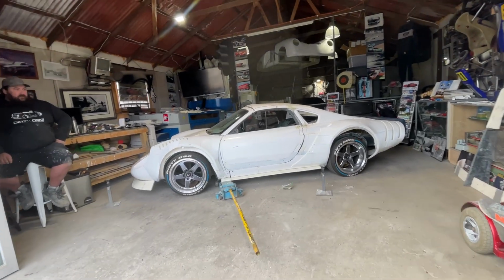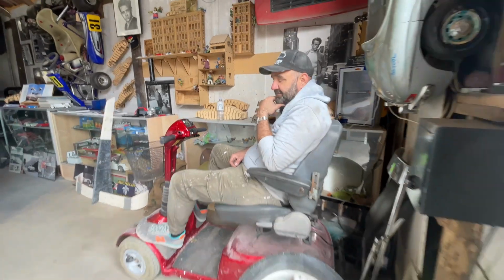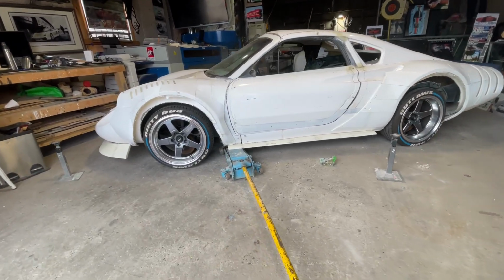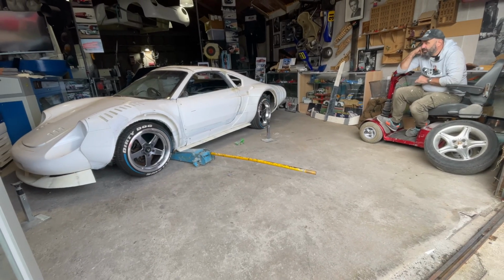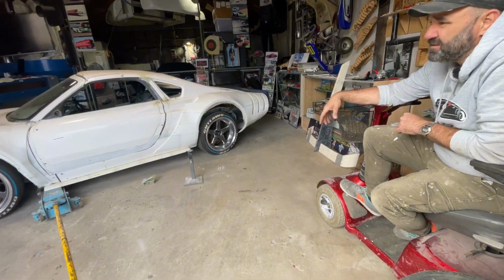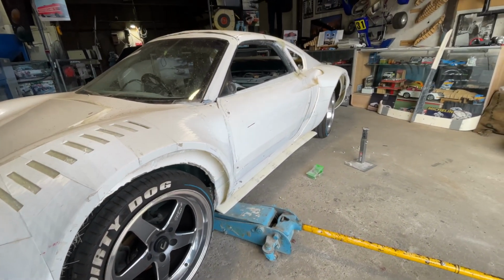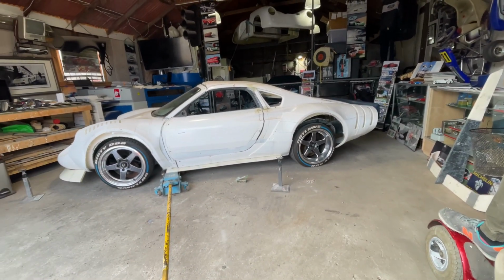Yeah, it's looking the part. Look, Davo, I know what you're like. But what this car needs now is tweaks. And those tweaks, and we've already got underway, are these rear flares got to come down by 4 inches. The front flares, I reckon, the same, maybe 3 inches at the front. That'll tuck and bring the tyres really in line with where the wheel arches are. Then what we've got to do with the side skirt is add on another, whatever, 100 mil on that side skirt.